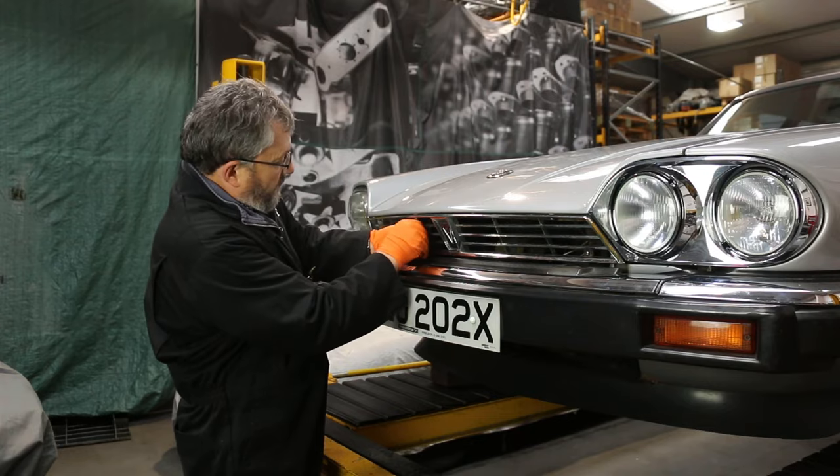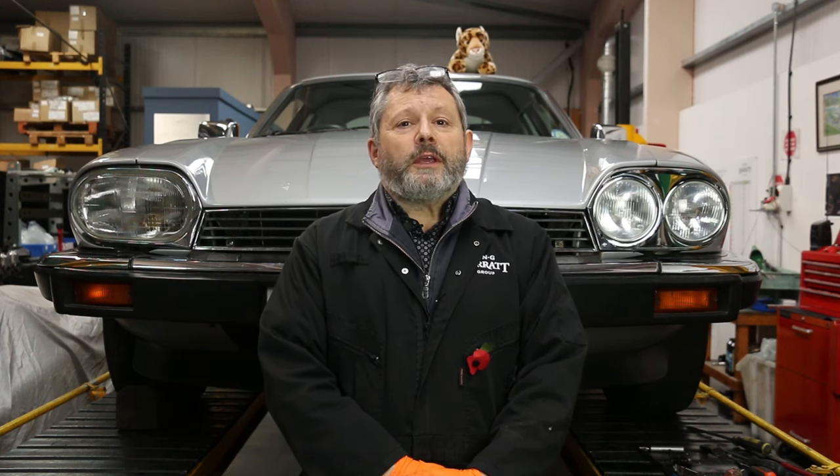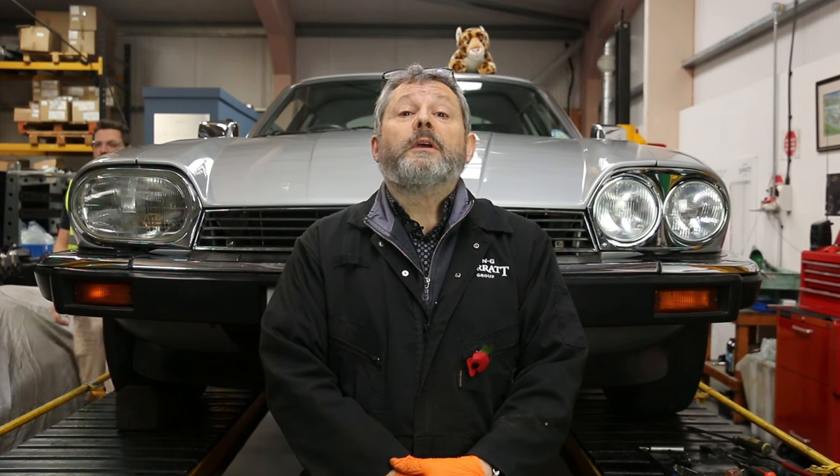Most if not all exports to the USA have the quad lamp twin system. So that's one side fitted — obviously I've got to do the other side as well. Once they're both in, the next thing is to set them up so the beams point in the right direction. The easiest way to do that is to take it to a local MOT station and let them set it up on their beam tester. Thanks for watching — don't forget we'll be giving this car away at the NEC Classic Motor Show, coming up soon.